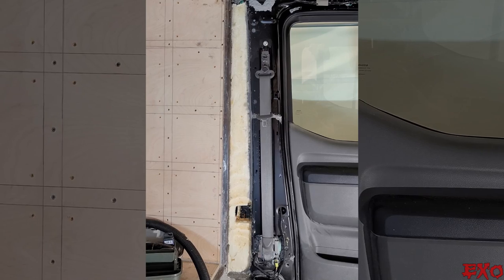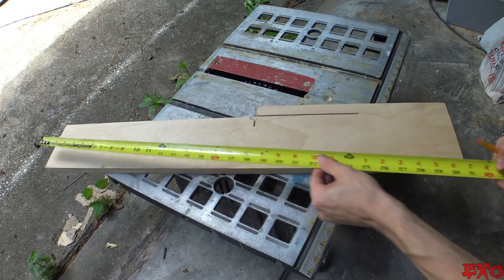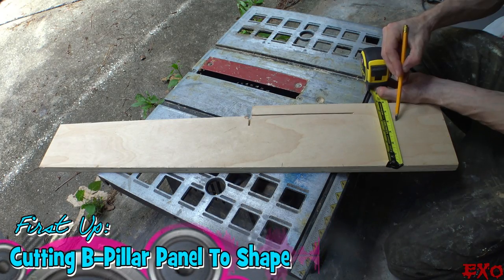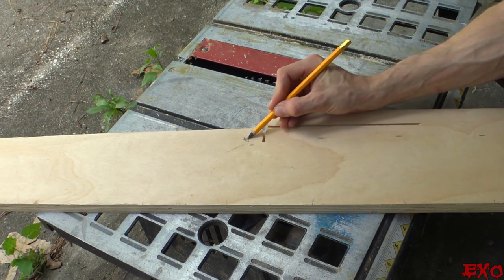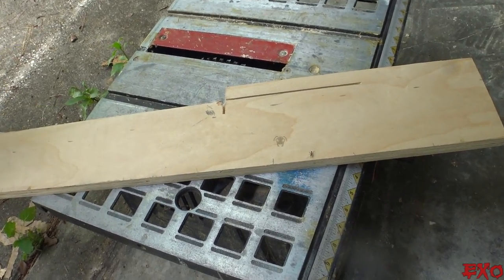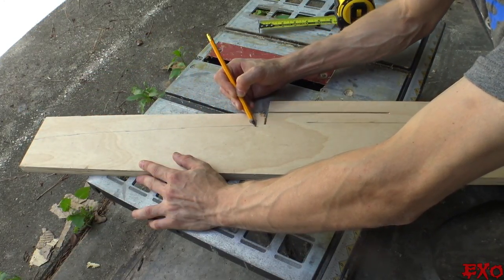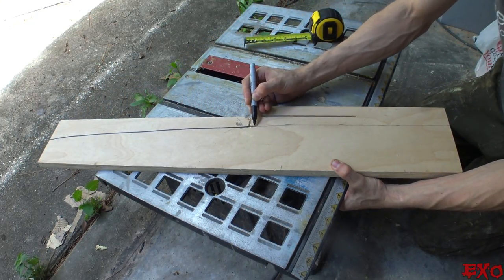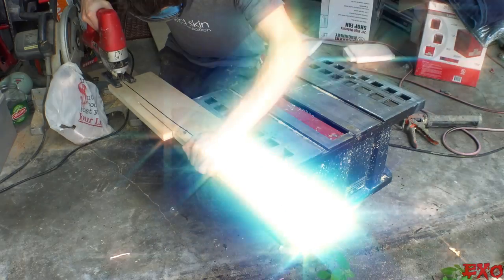To get just the right amount of taper into shape though, I simply measured across every 4 inches going vertically. By marking each line in a row, the curve comes out automatically with a quick game of connect the dots. Nice gradual curve, nothing special, just needs to fit.